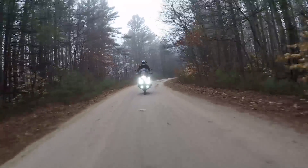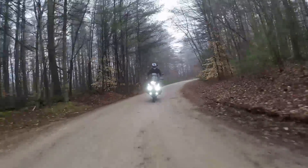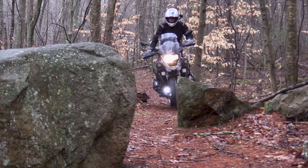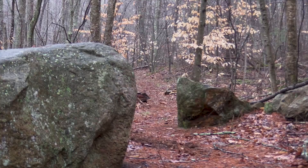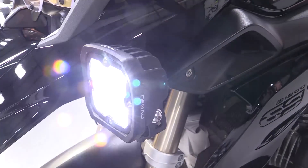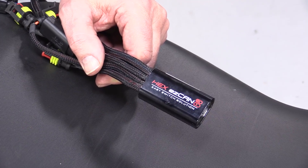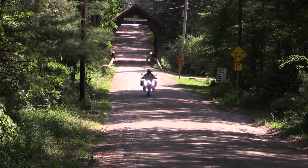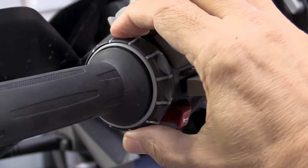There are a couple of differences in the way these devices work that you should be aware of. The Denali CanSmart is capable of operating and switching two pairs of lights, while the Hex EasyCan is designed to manage one set of lights. Although you can connect a second set, they will just turn on and off with the ignition and can't be controlled through the bike's existing switch clusters the way the CanSmart does. The CanSmart gives you independent control of two lights — not just for on and off, but for intensity levels as well, which you can adjust literally on the fly.